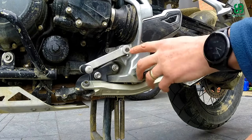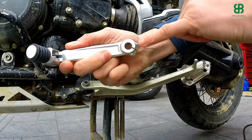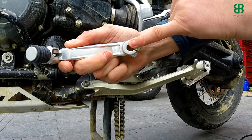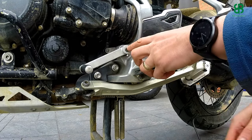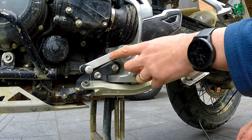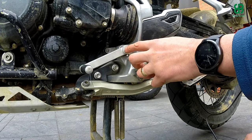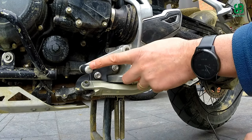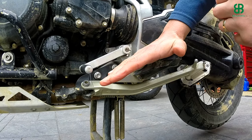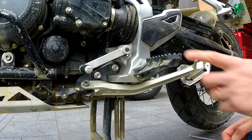So this process is really straightforward. In here we've got a pinch bolt — there are two dots aligned here. On the new lever, where the pinch bolt goes through, these are internal splines that sit on an external spline shaft, and there's a little dot machined in there — that's a point of reference so you can align them. The one presently on the bike was already bent from when I dropped the bike up in Kielder Forest. So I've aligned it one notch north — one notch up — which raises this point a little bit higher. When I'm standing up riding, my feet are in a more horizontal plane, so I like this peg to be slightly higher for changing gear whilst standing. Let's whip this bad boy off.